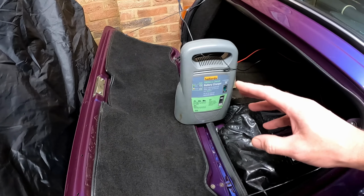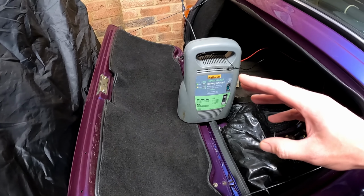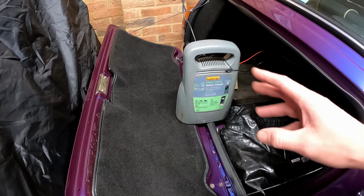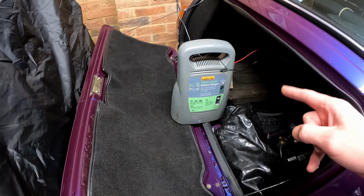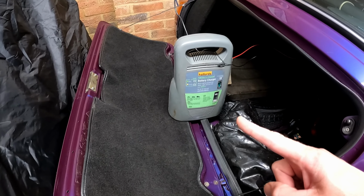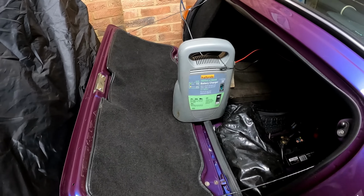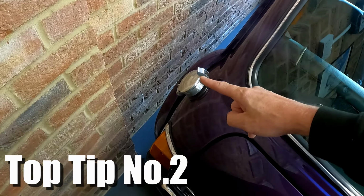volts. So we'll fully charge it, and that should give us a rested voltage of around about 12.7 volts. So 2 to 3 months time without being charged, that should be absolutely fine. But any longer than 3 months and we want to top the battery back up again, even though it's disconnected from the car. So let's get it charged up, then we'll disconnect it, and that battery's going to be good for 3 months. So tip number 2 is fuel.